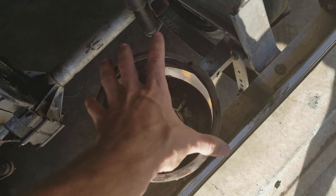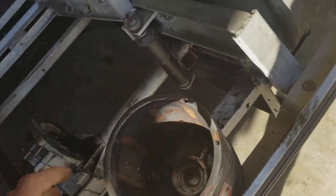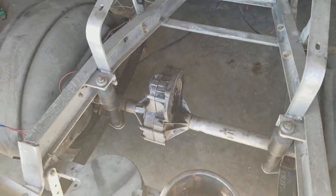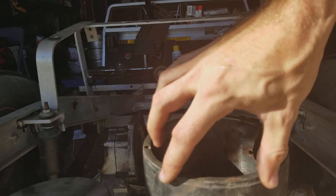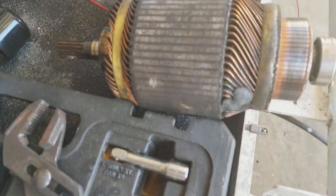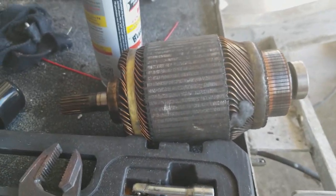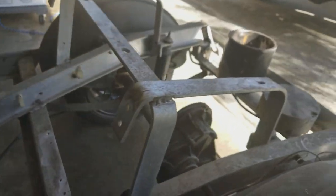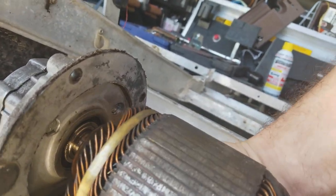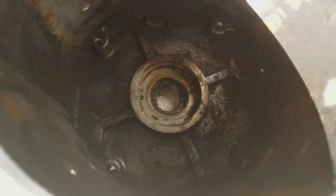So what I did was I took this motor apart — it's in a whole bunch of pieces — but this would be the portion that plugs into the sprocket there. Once you get that cut out, you can make room for your spring. I've got to take this over to a machine shop — this is going to be my drive axle — just got to get the actual axle pressed out and then keyed; I'm going to put a keyway in it. It goes right in here, and there's a bearing here and a bearing here, and those bearings will be supported by this housing.